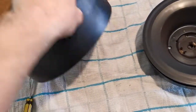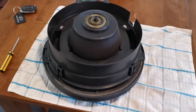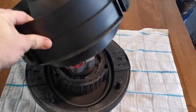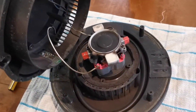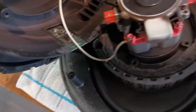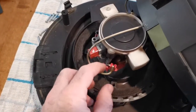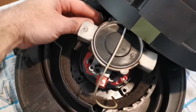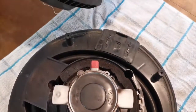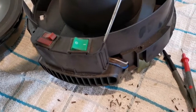What we're going to do now is flip it over and remove the central three screws. With those three screws out of the underside the top now lifts off nicely, and you've got two cables connecting the ring buttons to the switch, cables coming from the switch to the motor, and there's also a PCB there as well. Lay the lid to one side - you've got these spade terminals which just pop off the motor on each side. We can get to the switch by popping out these clips on either side.